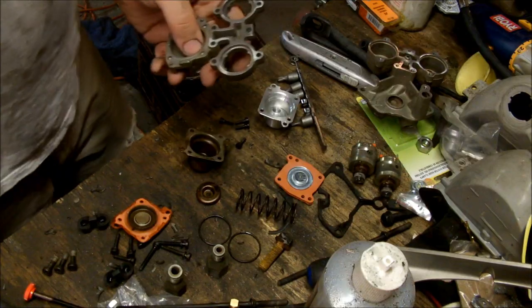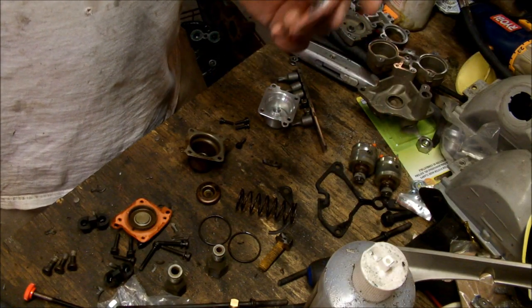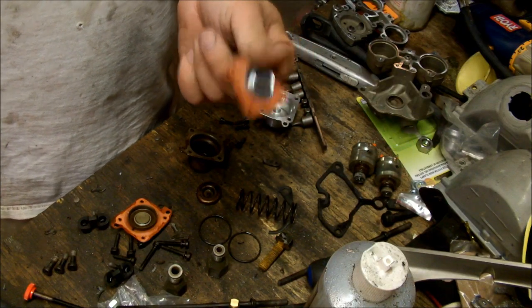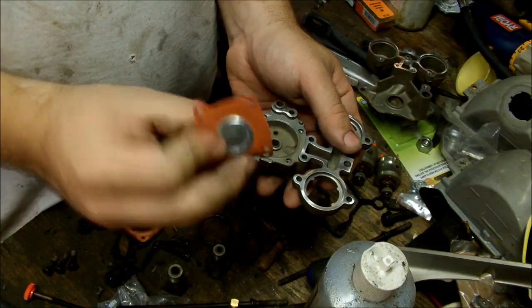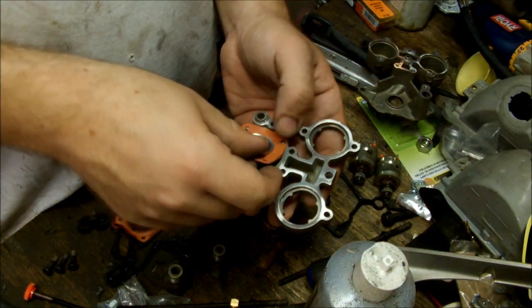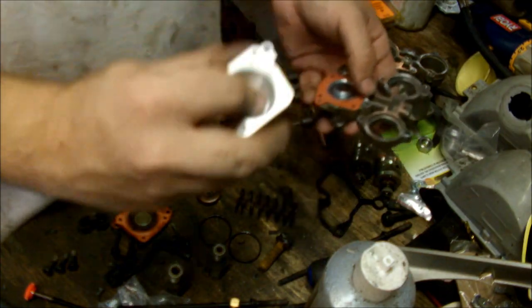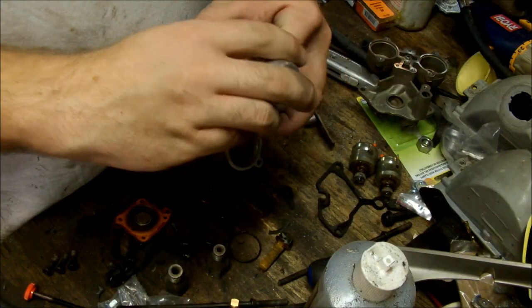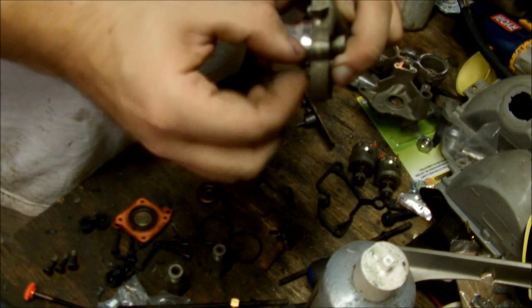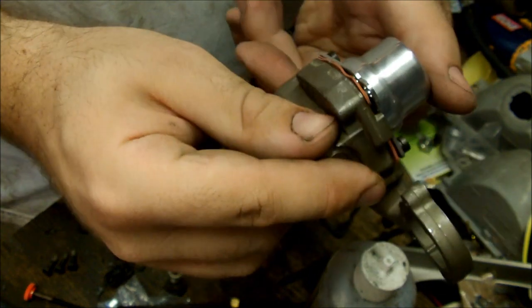What I'm putting in is an adjustable fuel pressure regulator from CFM Technologies. It does not come with a new regulator diaphragm — that came in the throttle body rebuild kit, which has all the gaskets. It's pretty straightforward: you take the top of it — this part with the indent in it — goes like so, then the kit comes with a new bottom to the regulator and you reuse your existing spring. You want to make sure you didn't pinch any of the diaphragm, that it's even all the way around, or else you'll have a leak and won't be able to regulate fuel very well.